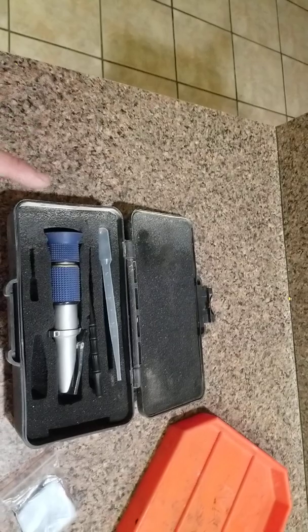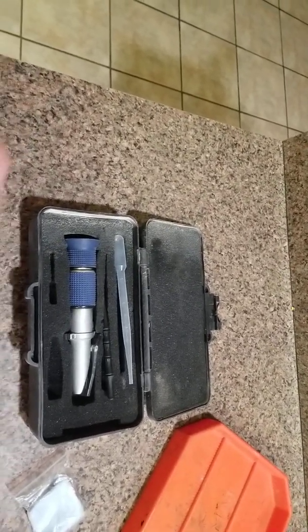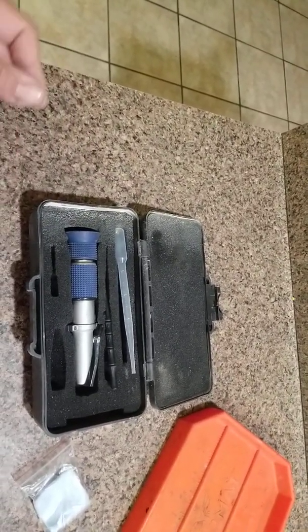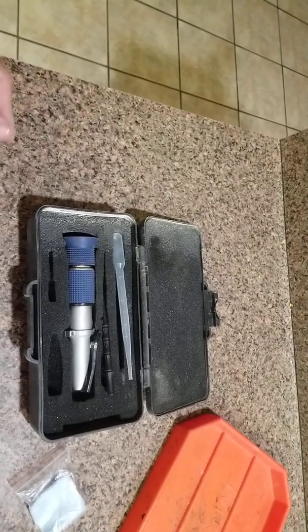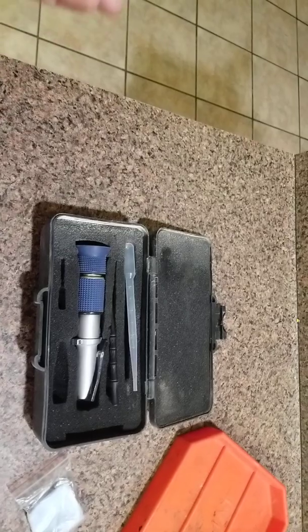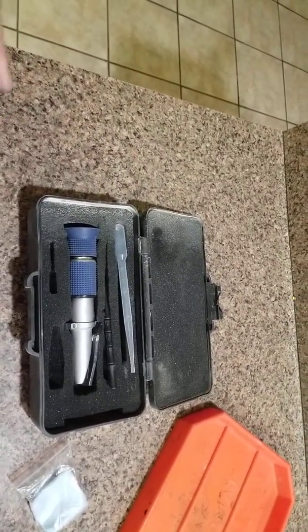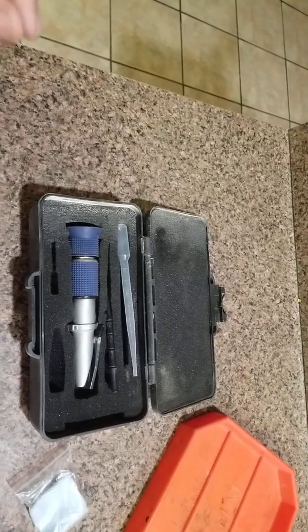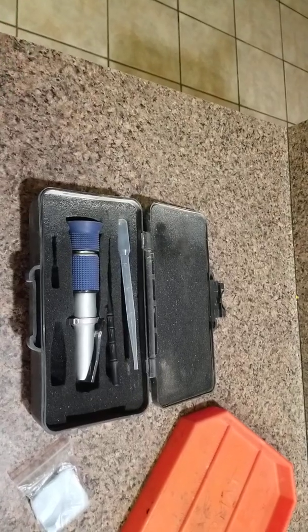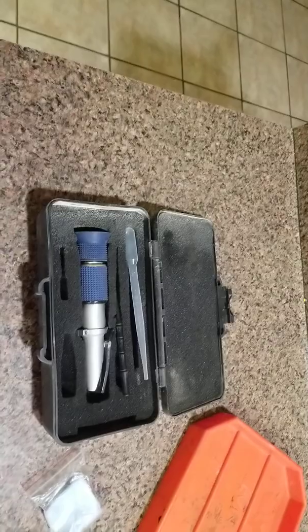By the way, anytime you're working with DEF, I've come to be a big believer in, first thing you do, drain the tank into a bucket, see what's in it, and then refill it with brand new, known, good, reliable DEF fluid. DEF fluid, depending on the brand and the make, tends to have a variance in its ability to create faults in the system. 3285 is one. So, go with a reputable DEF fluid and replace all of it. I'm a big believer in that. You know what I mean?